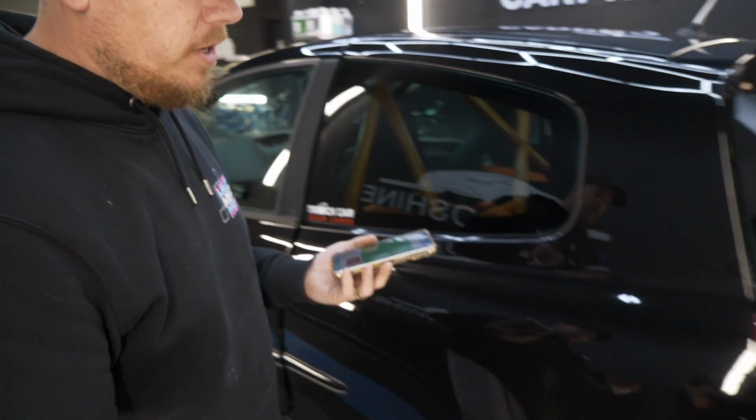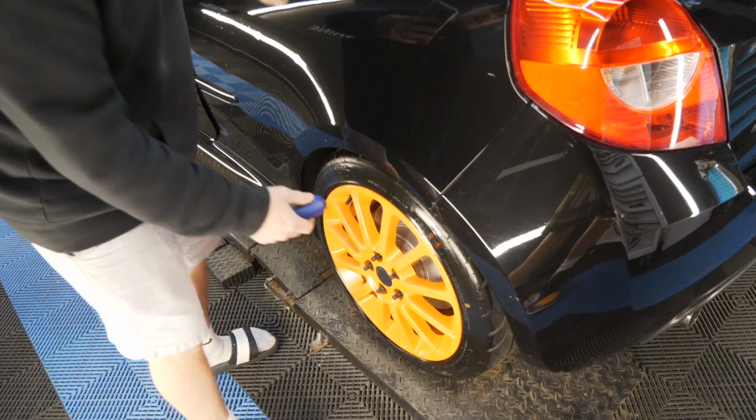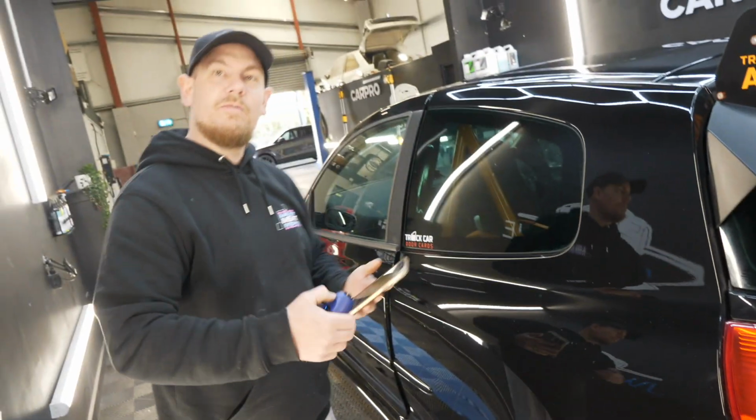And just to show you guys, this isn't a fake thing. These are aluminium, as we know. And we can test how thick the aluminium is and the powder coating. Aluminium says it there. 183 microns. Fresh powder coat. Fantastic. We know that, that's good. Okay, so paint on the bonnet is original.